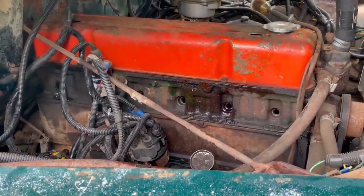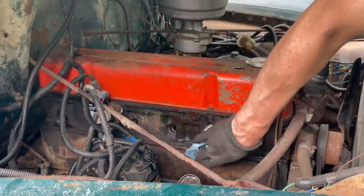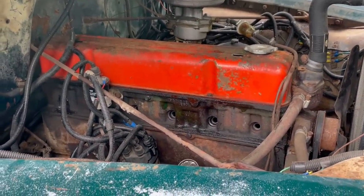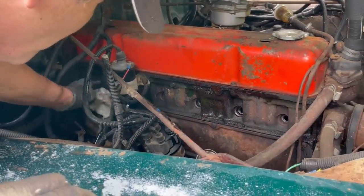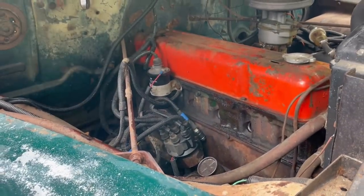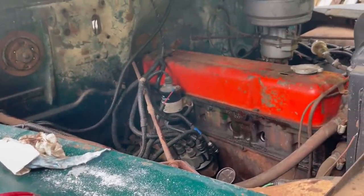That's okay. I mean, I gotta expect that. With an engine that's been sitting, it's not gonna have perfectly seated rings like that. What matters to us is that the oil's no longer in the cylinder area. So to make absolutely sure, I'm gonna try it once more and make sure that there's no residue left. The more oil that's in there, the harder it's gonna be to start.